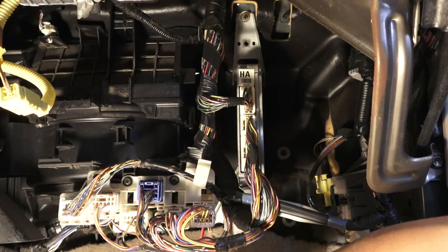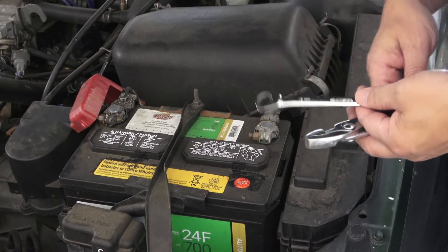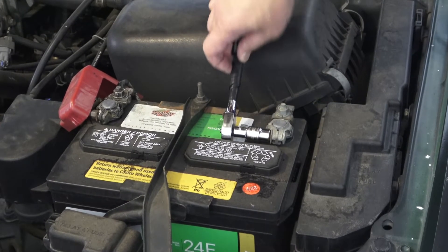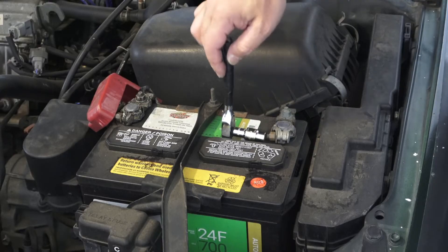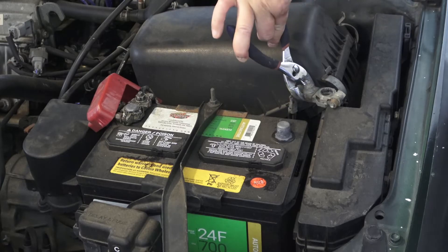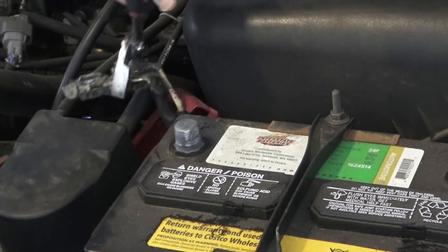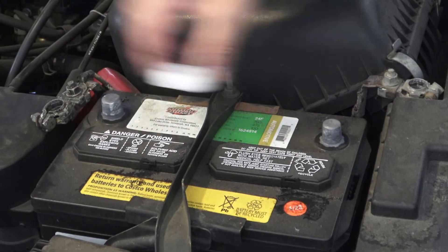Focus is really important now. I'm going to work on the radio, so I'll disconnect the battery — disconnect the negative first. Make sure you turn everything off in the car so there's no spark while disconnecting. If something is on, it's live and electricity is running to that load. I disconnect the negative and positive terminals and tuck them away, using a cap for added safety.